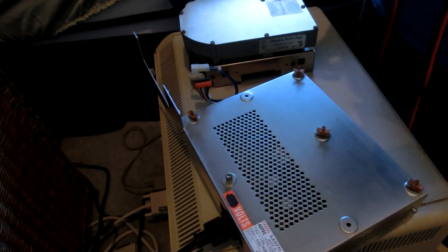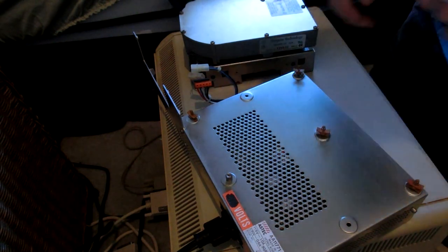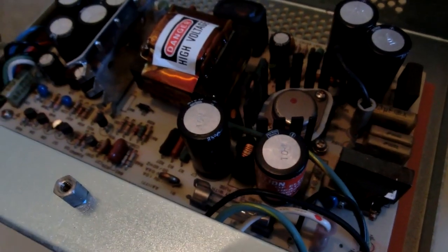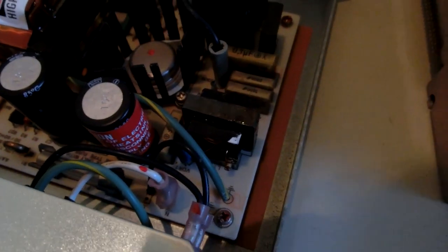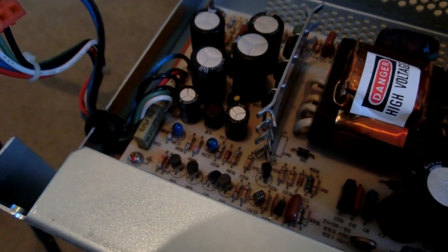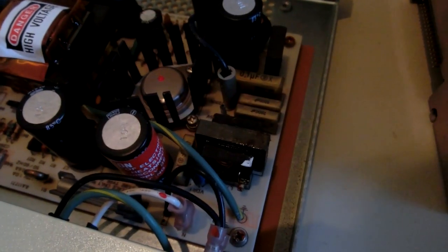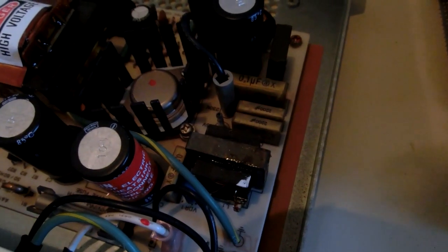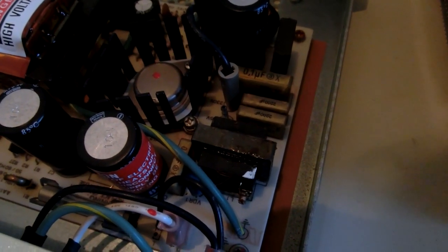So yeah, pretty much this power supply is shot — probably some bad capacitors. This is actually good because if that's the only issue I can probably fix it. Here are the insides of the power supply — it's very simple and easily accessible, so I'm glad about that. There are a lot of capacitors, especially these filter capacitors — there are five of them — and those have an almost surefire tendency of exploding over 30 years of use. That's a very good reason for a lot of Macintoshes dying, like the original Macintosh 128k. I think Commodores had them too, like the Commodore 64. I'm probably going to rip those out and replace them with more solid-state ones or ones without an electrolyte.